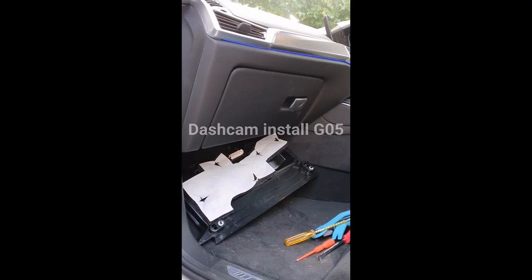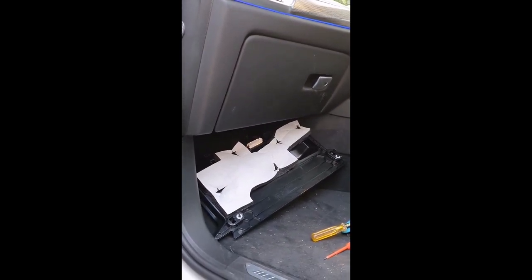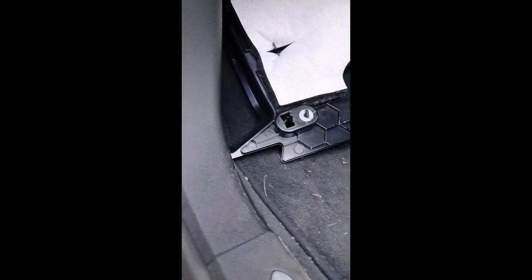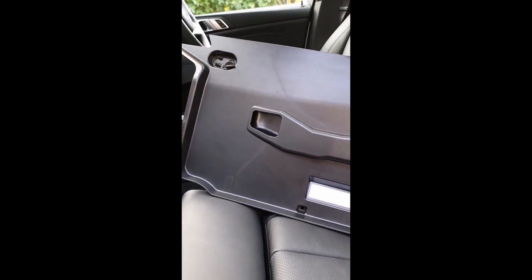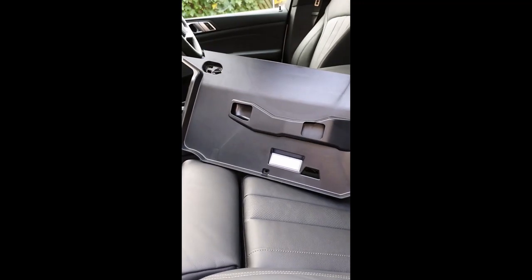This is the first stage — this is the left-hand footwell cover. Because this is a right-hand drive car, I've just rotated the lock pins and dropped it down, and I'm just about now to disconnect the connector for the interior light. I've just disconnected the footwell light connector. These are the two toggles that I've previously released and the whole thing's come out now and it's been disconnected.